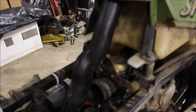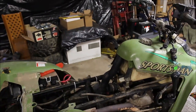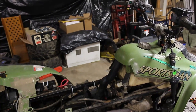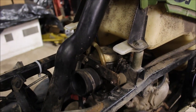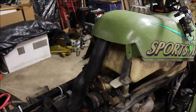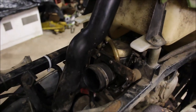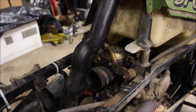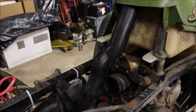With this video I want to show you guys a little trick that kind of bypasses the guesswork. In this case I think the majority of the problem is the carburetor — something doesn't seem to be opening and closing right. If I hit the gas it takes off like a rocket but then all of a sudden she just dies, and if I go up a hill she wants to die. A lot of that could be the diaphragm on top of the carburetor — maybe it's not opening. And once again that's a vacuum issue, not the right amount of airflow. Even though I cleaned it, there could still be something minor I'm not seeing.